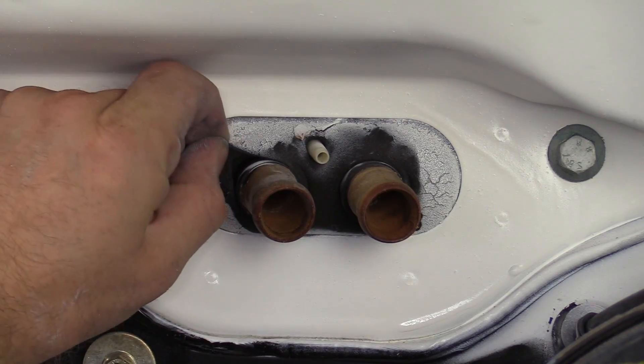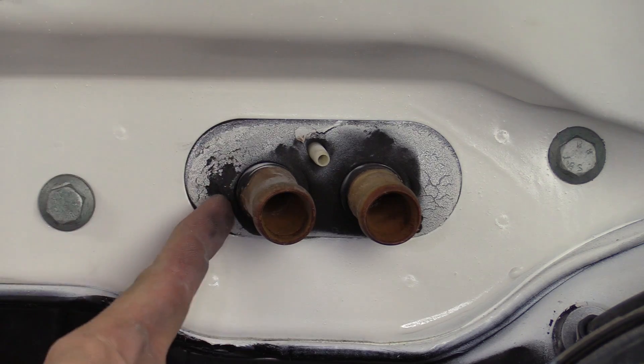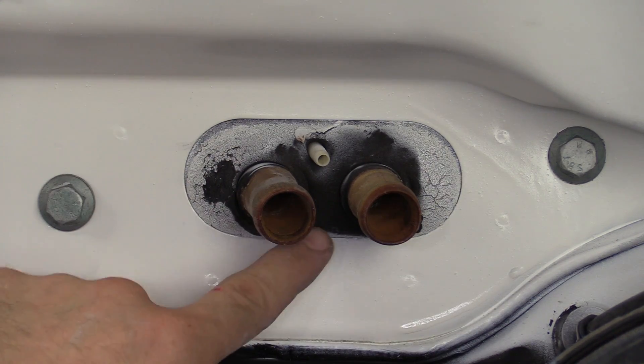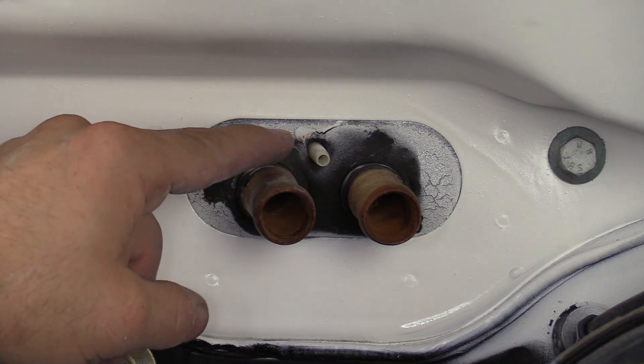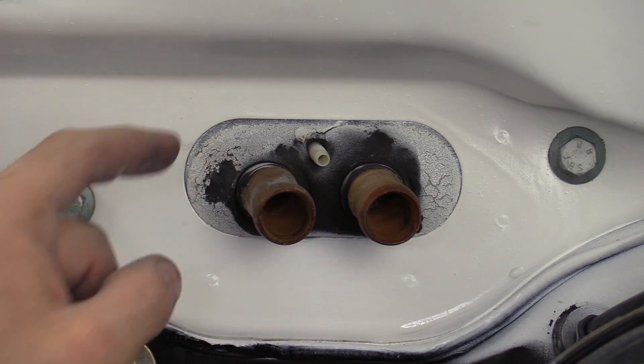There are some things you really absolutely do not want to get paint on. This piece of foam around the heater core is one of them — there's not really anything that works well to get paint off that won't also destroy the foam. So again, if you do not want paint on it, make sure you're covering it up. And finally, if you want to go the extra mile and make it look even better, you can always do some sanding and wet sanding to really get an amazing finish.